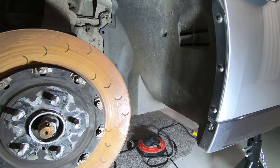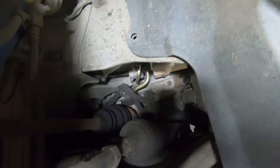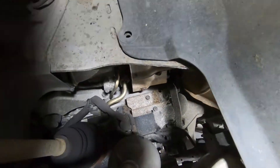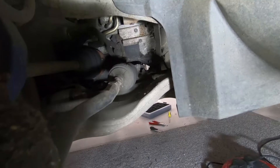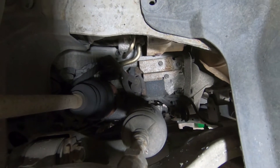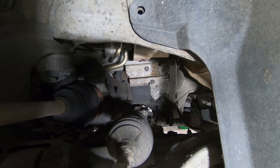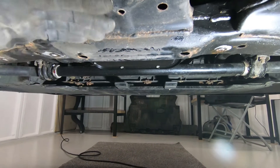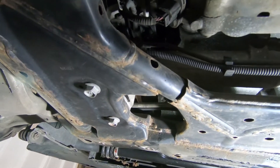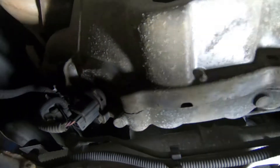From the left-hand side of the car, looking through the wheel arch, you can see this is the starter motor right there. The first thing we're going to need to do is remove the harness from underneath. Underneath the guard, we've removed the rear sump guard — that's the plastic cover underneath the car — and if we look, this is the cover for the flywheel, and the starter motor is attached to this.